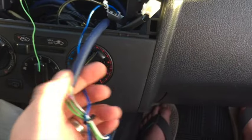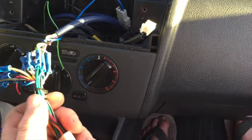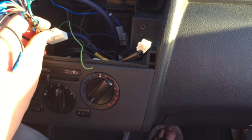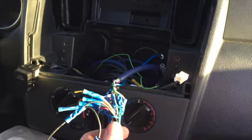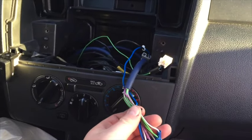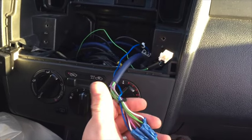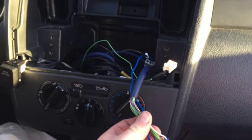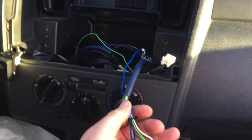I highly recommend this stuff — it's awesome, super easy, and nicely labeled and color-coded just like your wiring harnesses. The speaker output from your four-channel amp runs up here, then I wire that into the factory harness so when I plug that in it goes to the factory speakers. That eliminates the need to run new speaker wire to each door. If I were running high-end Hertz, Audison, or JL speakers I'd probably upgrade to heavier gauge wire, but the Kenwoods in here sound just fine on this amp.